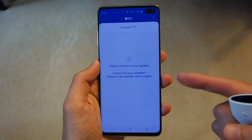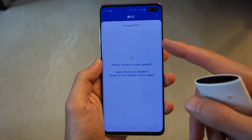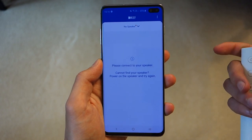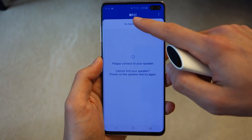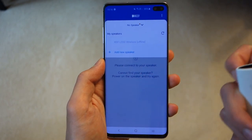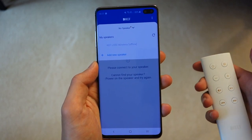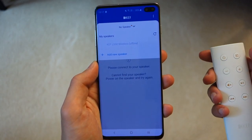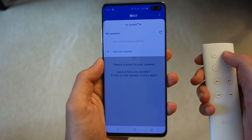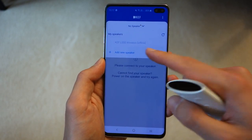So now let's talk about the app. There are two apps to download: the KEF Control app and the KEF Stream app. The one I'm interested in right now is the KEF Control app. Even though we've got a wireless product connected to my PC via USB, you can see that the KEF LS50 Wireless shows as offline. The reason behind that is because it's in PC mode. This means that each time you switch on the speaker, you have to go into wireless mode. I have no visual indicator, so I have to change inputs and guess if it's selected to the right input or not.